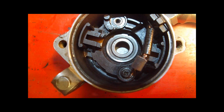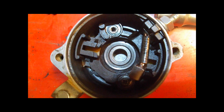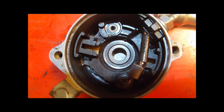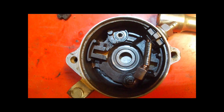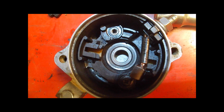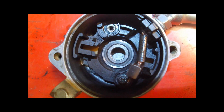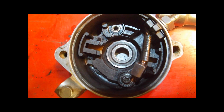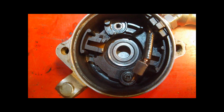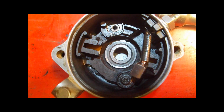I don't think there's that much wear at all, so I think I'm pretty much good to go. I'm just putting this all back together, and I got the one brush in already. It goes together pretty straightforward. Definitely check out the video of Slavens doing this. Shows a really good trick of using tweezers to hold the brushes in place while you put the armature in. Otherwise, it's just a nightmare to try and manipulate all that at once. A great trick there. I've used it already once.